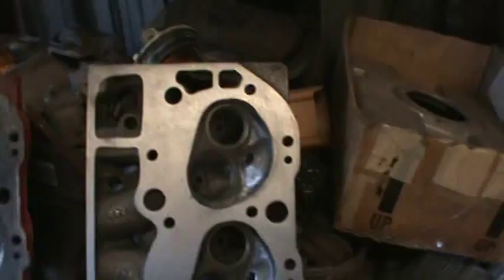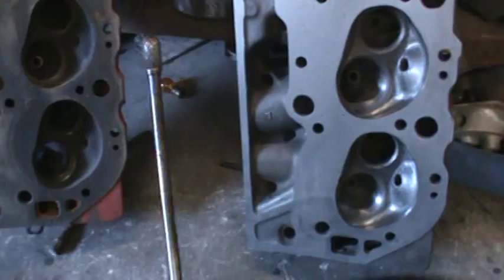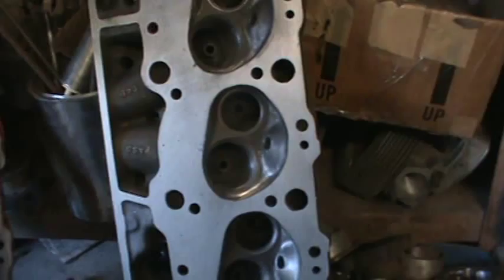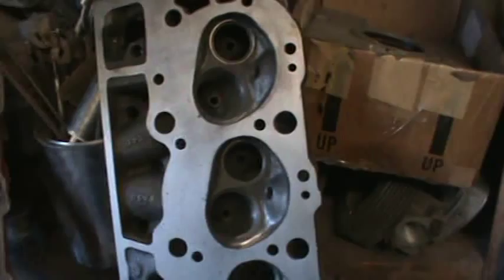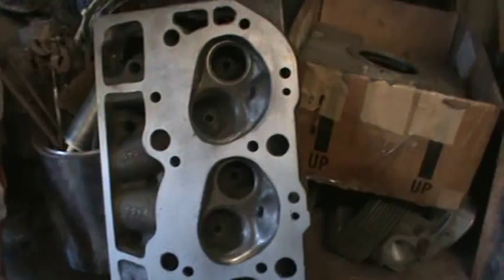That's my take on the finish on the port. You don't want to polish it. These exhausts have been sitting for a while — they're ported too, but they're smooth. You can polish up the exhaust port to a high polish if you want, but you don't want to polish the intake unless you're going to turbocharge. Leave it in the 80-grit finish with the sanding roll. The super stock guys I used to work with would leave the intake ports in the carbide-bit finish, and if you look at a CNC port, it has that same finish. A lot of guys say that atomizes the port. When I worked for Brad Anderson, we had CNC-ported hemi heads that were nice right off the CNC machine, but you could always go in and enhance the turns and clean them up a little to make them work better.